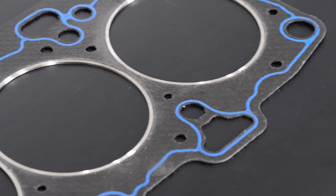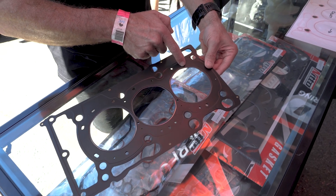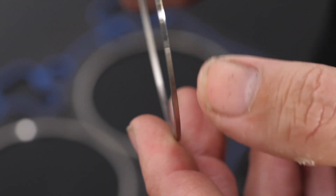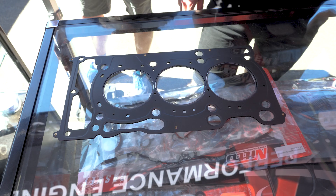Can you talk to us a little bit more about this stainless o-ring — what that actually means and how it improves the head gasket sealing? Basically, that stainless steel o-ring is a feature we've incorporated into all of our gaskets. What it does is enable the head gasket to seal off the combustion chamber far more efficiently and more tightly. Now there's a bit of a balancing act here, because the head gasket has at least three functions.